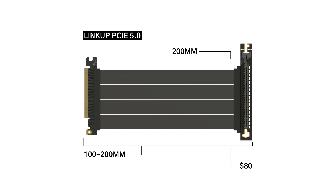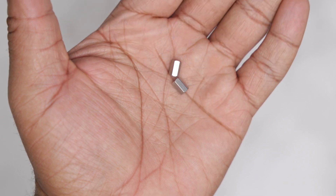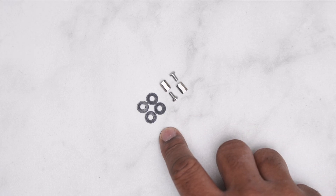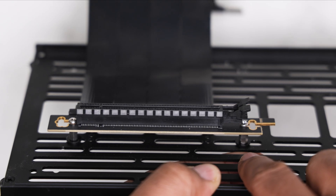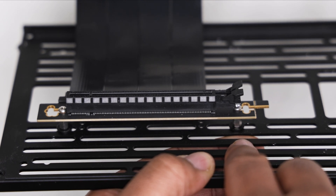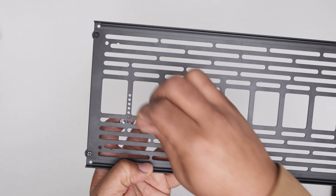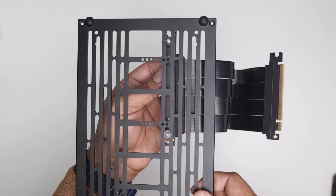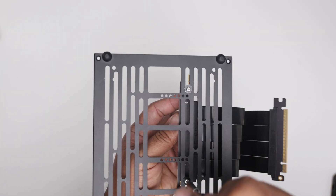The Gen 5.0 cables are very expensive. You're also going to need two female-to-female 8mm M3 standoffs to elevate the riser, and four 1mm thick M3 washers with an outer diameter of 10mm to keep the standoffs secure. Simply attach the standoffs to the riser with two M3 screws, then use two additional screws and washers inserted into the bottom of the panel with two additional washers on the other side. You may have to keep the screws loose at first to get the riser bar lined up, but once you have the correct spacing, you can tighten everything down.